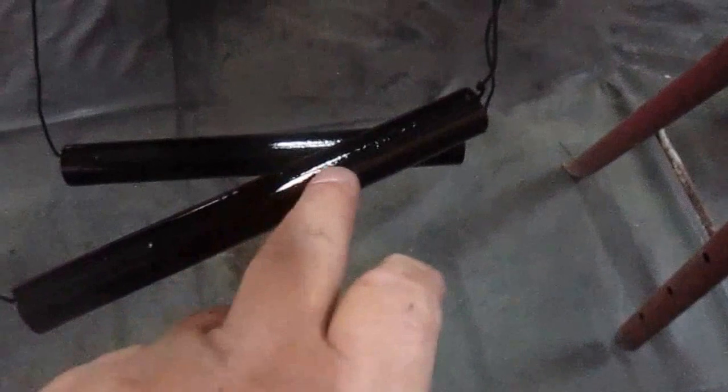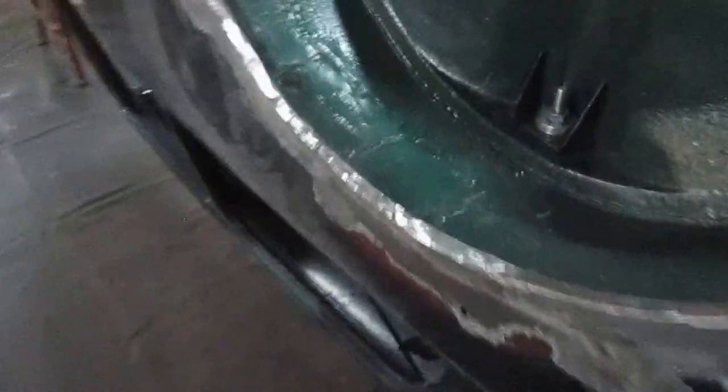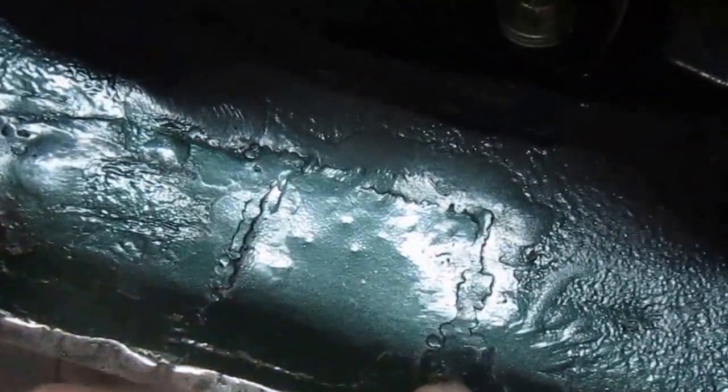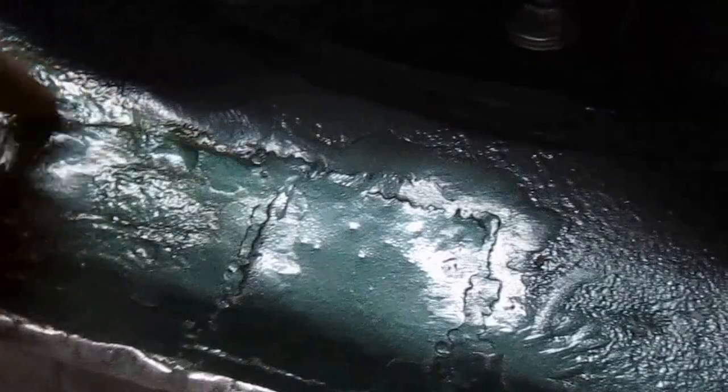They're for the XJ. They call these distance tubes. This is what the shafts for the fulcrums go on. What we're going to do now is take this one out, which is not very nice. For some people that would be a reasonable patch, but it looks shoddy. So we're going to cut this one out completely, and again roll a new panel, and then we'll butt weld it all the way around so it looks real nice.